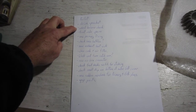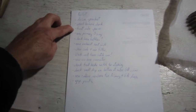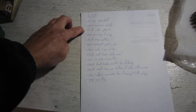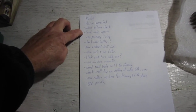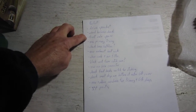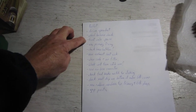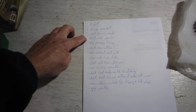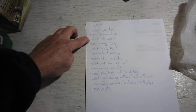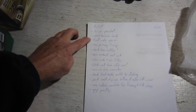So I think I've got a slight imbalance. I'm gonna take the wheel off and check the balance. While I've got it off I'm gonna put a spacer in — I put a temporary one on but I'm gonna make up a nicer one. It's the spacer for the brake between the brake and the left-hand fork. There's a spacer that allows that nut to back out, and then your plate wobbles around, doesn't stay centered, so I'm gonna sort that out.